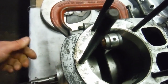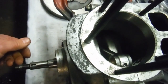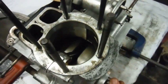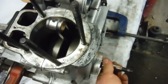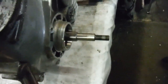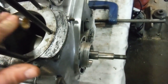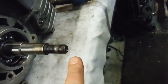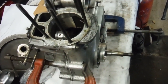It's spinning nice and freely in both directions. There's absolutely no binding or drag or anything there. There are no signs of the crankcase trying to walk against itself even before I did the clamps up. So I'm actually going to say that this is good to go — although it would have been impossible to get low and accurate readings between centres on the lathe, thanks to the runout between the centre hole in the main shaft and the outside diameter of it.